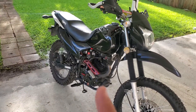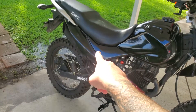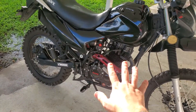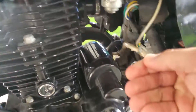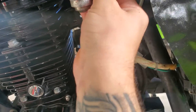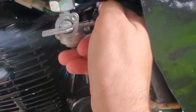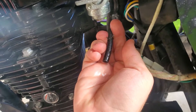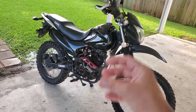I have it inside right now, but I'll put a picture of it right here. Step one: you're gonna want to get your gas tank, side fenders, and your seat off — well, maybe not your seat, but it just helps. What I'm doing is taking the whole motor out. Step one: shut your gas off. Step two is take this petcock off. You don't want it feeding any more gas to your carburetor. Let a little bit of gas leak out, then put it on a paper towel. Get your side plastics off.